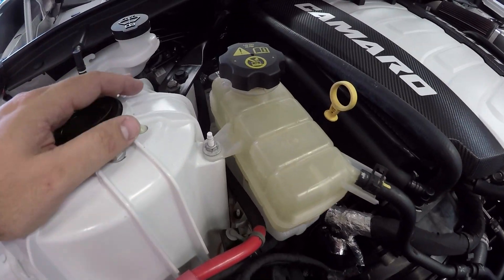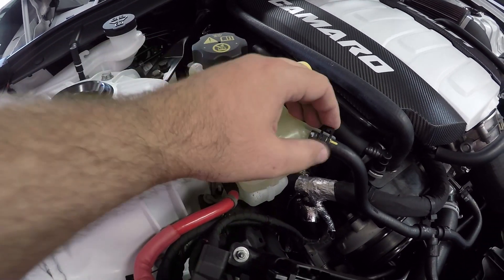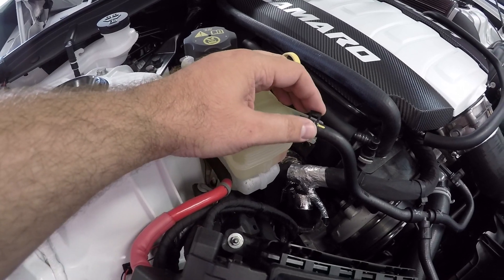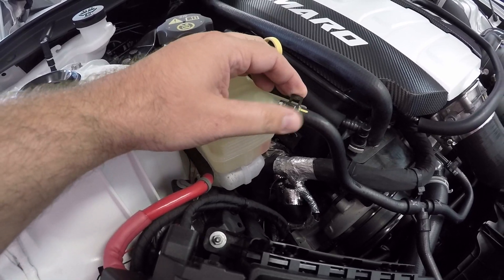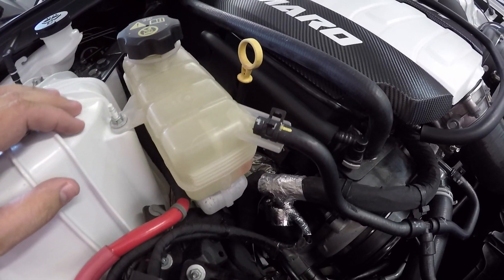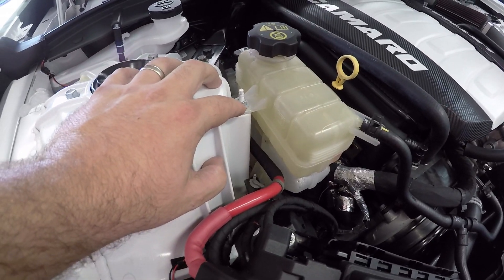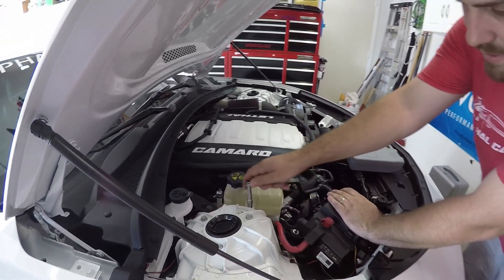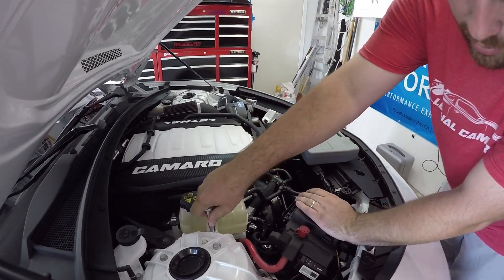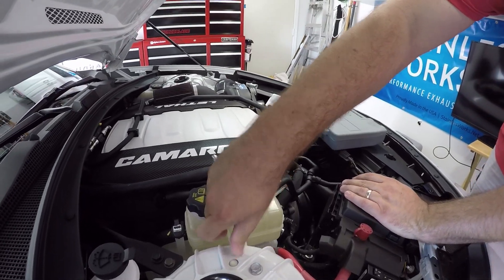For the install, don't let it be scary. Basically all you need is a pair of pliers, a wrench, or vice grips — whatever you have in your toolbox that will squeeze the clamp holding the hose in place on the front and back side. You also need a ratchet or socket to remove the bolt. First step: this is a 10 millimeter bolt, so a 10 millimeter socket fits. I'm just going to unscrew this.